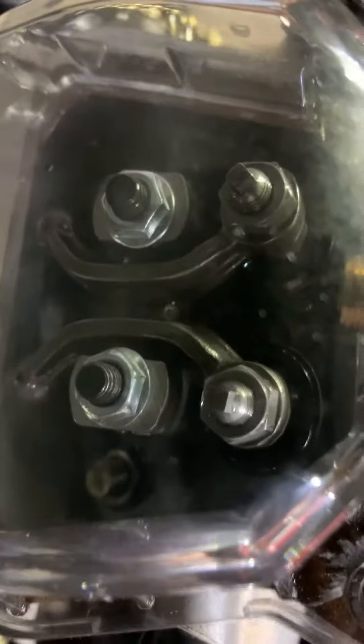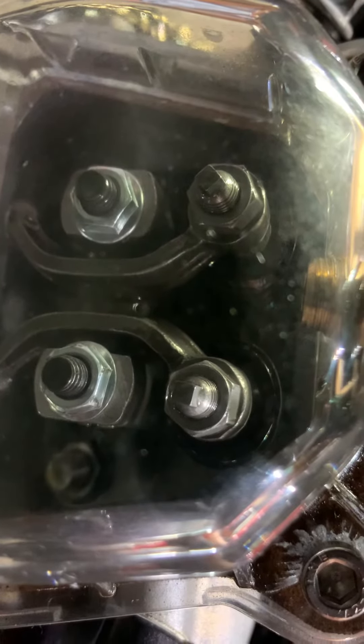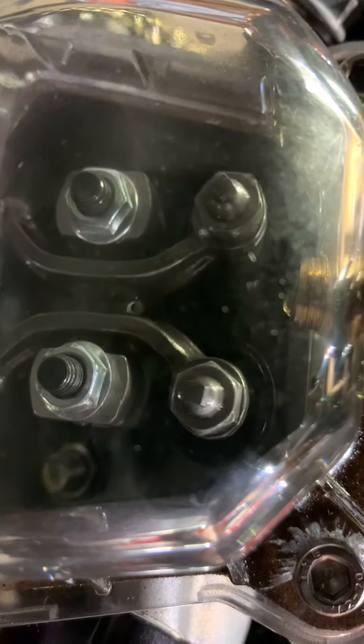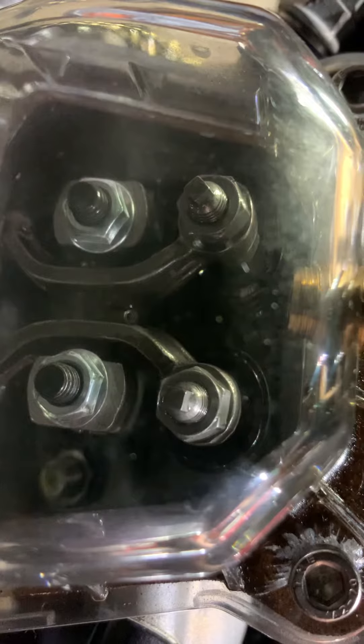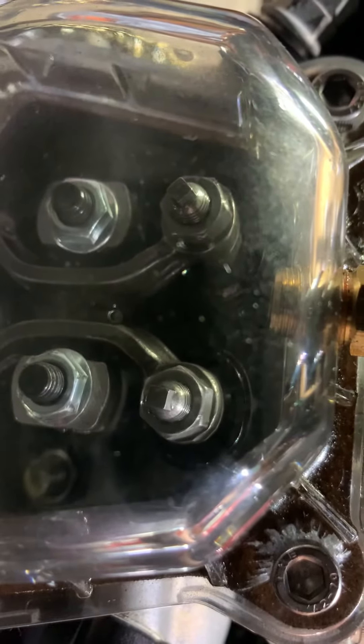If you take a look, the left is the exhaust valve and the right is the intake. Let me turn this over by hand — so that's exhaust, that's intake. Now it's supposed to blip the exhaust. Nope, no blip.